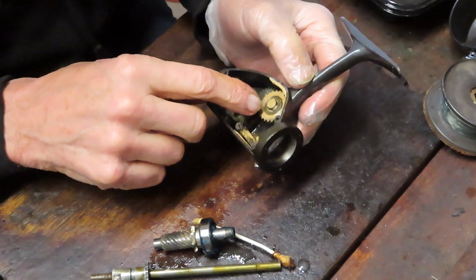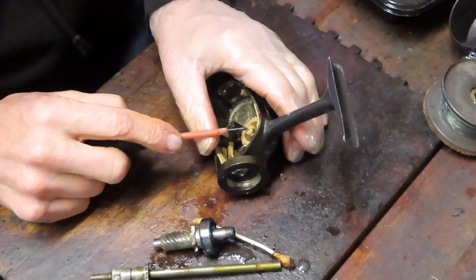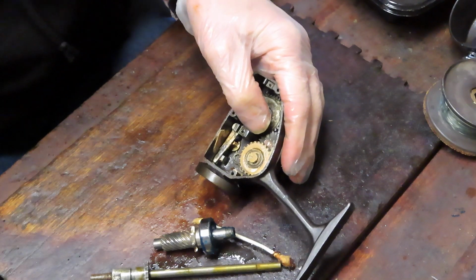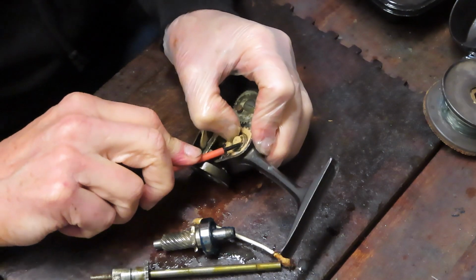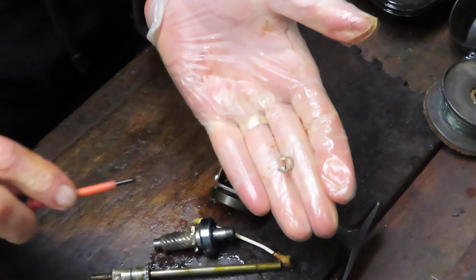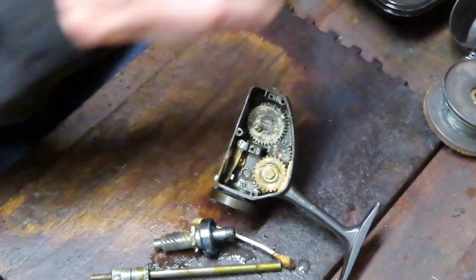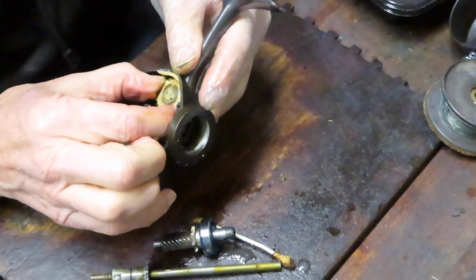Okay, there's a C-clip that's holding on that, I'm going to say it wrong, I'm sure of it, helical gear. There's just some words that you're just never going to get right. When I take a C-clip off, usually I can get them off with the screwdriver like I did here. And that's the one, I guess it's an E-clip, there's a third tag in there. But that's the clip we were removing to the parts tray because that'll be a hard piece to find. Now we can remove that gear.